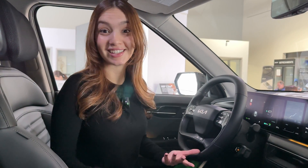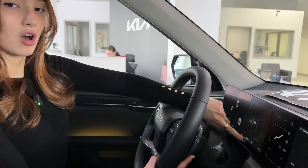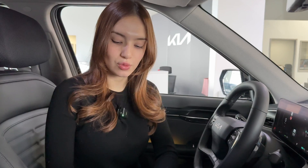Now let's talk about how you can do it on a car that does not have this easy shortcut. First things first, get to your steering wheel. If you've been driving your EV for a while, you're probably used to your paddle shifters. The one on the right decreases your amount of regen. As you can see on the gauge here, we're currently at max regen. Press the right paddle shifter down to level zero. Once at level zero, the vehicle still utilizes a little regen under normal driving, but if you do a hard braking cycle, it will know it's in brake disc cleaning mode. You won't get a notification like on vehicles with the auto hold shortcut, but the vehicle will still utilize its friction or mechanical brakes. This is not bad for your car — it is normal operation. This vehicle is meant to use a conjunction of mechanical braking and regenerative braking.